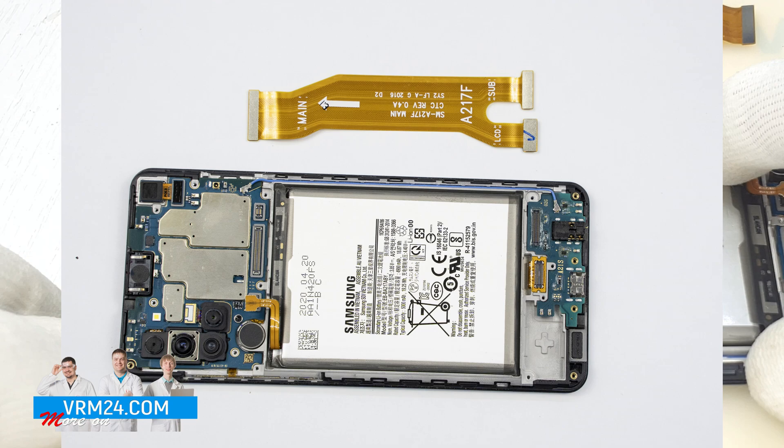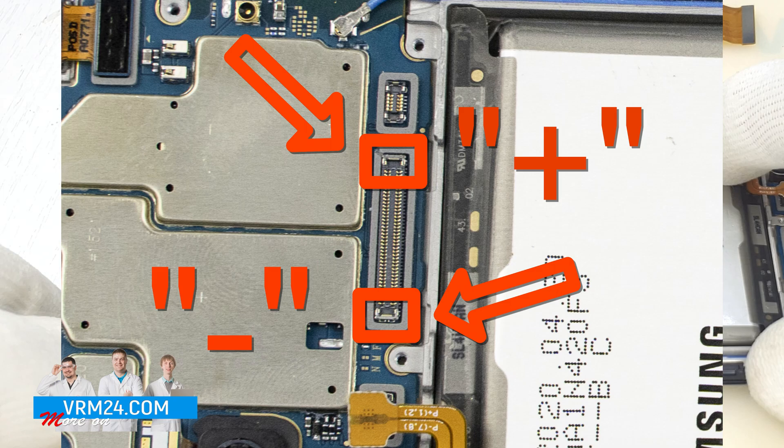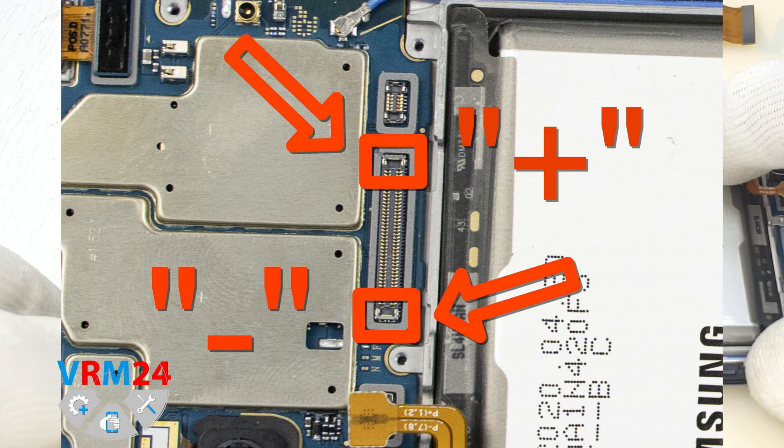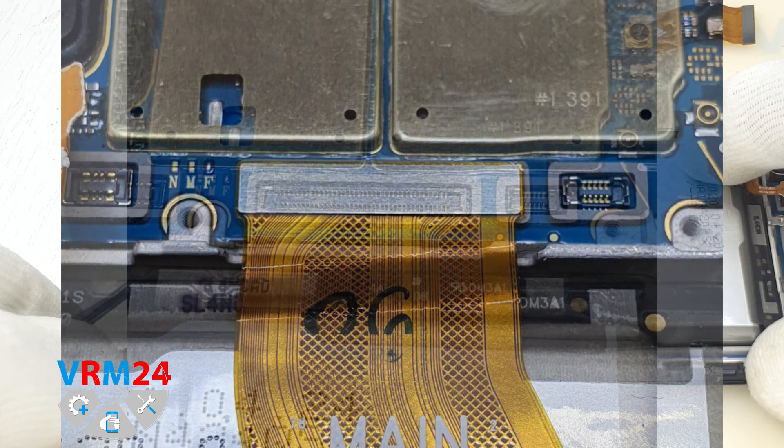However, we already know that in this model the pins of the interboard cable connectors — plus and minus — come from opposite sides of the connector in the form of metal brackets. The connector's rigid construction and the highly taut cable make the connector's pins vulnerable to bending damage. This unfortunate technical solution has turned it into a common malfunction.